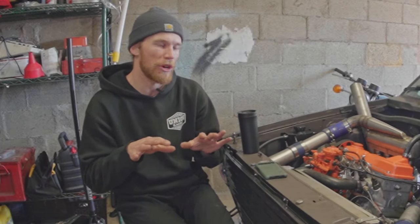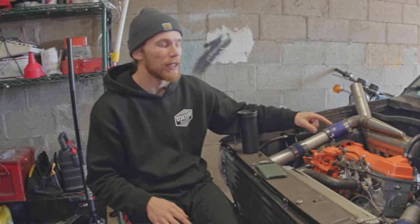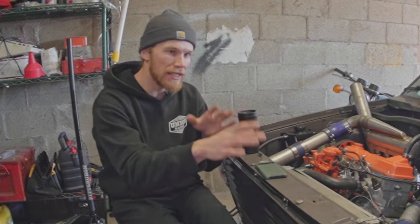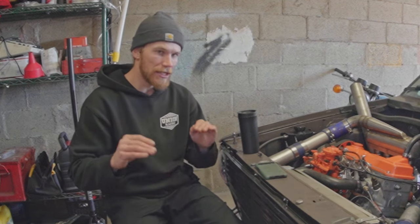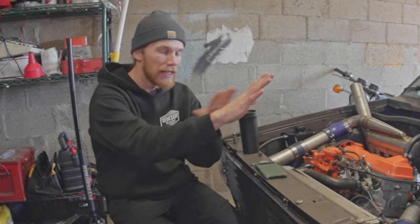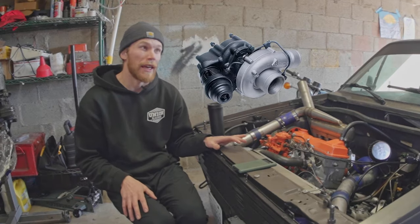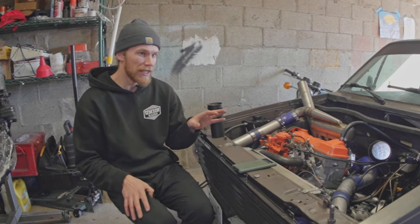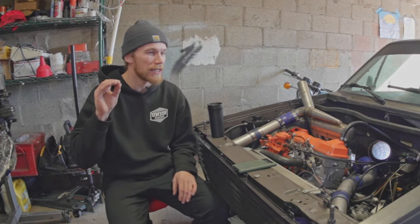Let's say you did all those modifications — you've tuned your fuel pump, increased wastegate pressure, and added an intercooler. On the stock turbocharger things are probably getting kind of hot, so you have more options: time to consider a bigger turbocharger. From the factory these had a K15 and/or maybe a K17 turbo. The K15s are very small, and the tricky thing about turbos is sizing them correctly. As soon as you start adding more fuel, it starts to act like a bigger motor putting out more exhaust gases, so you can start running bigger turbochargers.